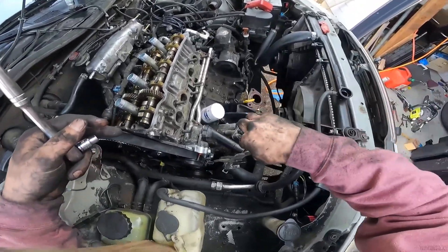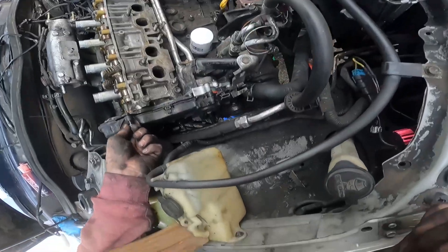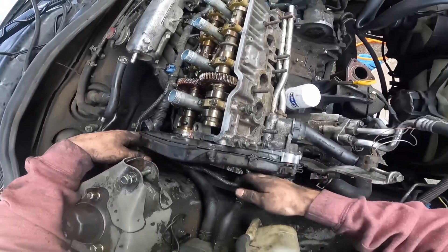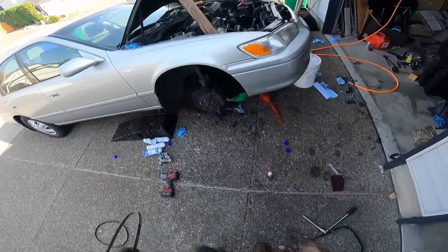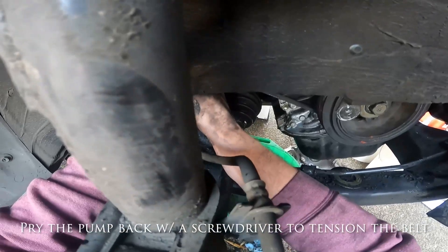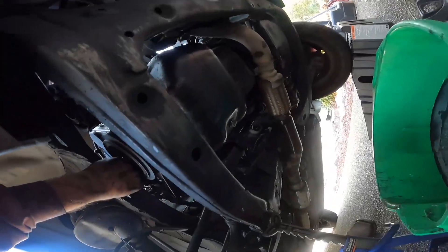Let's get this back into position and put on the upper timing cover. Let's reroute this wire back the way it goes so it doesn't get ripped off by these belts once we get them all back where they're supposed to be. Now let's get this power steering belt back on — it goes on the back rear pulley of the crankshaft pulley, then slip it up over the water pump, get that nice and tight. After you get the belt tight and that tensioner bolt tight, we'll go back up to the one we loosened earlier and snug that back down — that's the top bolt on the power steering pump.